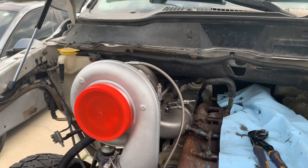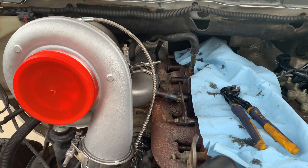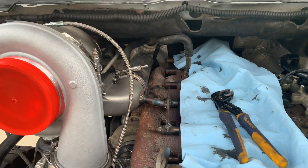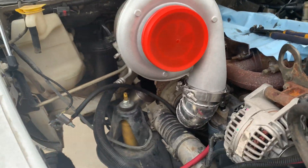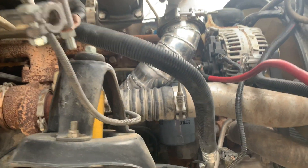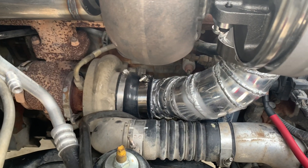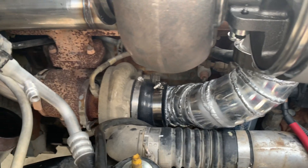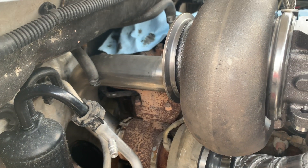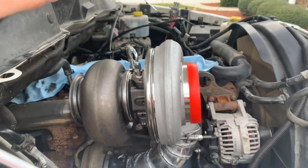This is what I've got so far — a little bit of bracing for the turbo. I just braced it to the exhaust manifold studs. I'll probably clean this up and add a few more gussets and that'll be good. Everything's finish welded. The intake is there — that was a pain to make. A lot of pie cuts because of the weird angle trying to get it down in there, but it just barely clears. Next thing is the downpipe — I'm going to try and hook it to the factory five-inch, and then we should be ready to start.